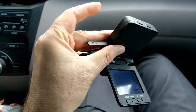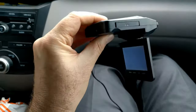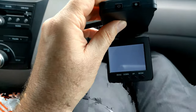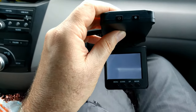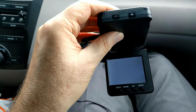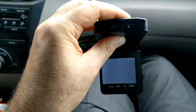So I played with this for quite a while — plugging, unplugging, trying all the buttons, taking the card out, trying it with no card in it. I think the problem is with the screen, because when I checked, there were recorded files being created. There are video files on the SD card. In my unit, I think this is a defective screen — that's what's going on.